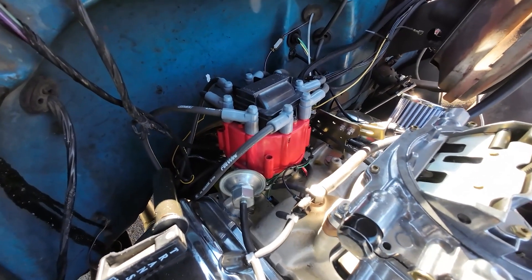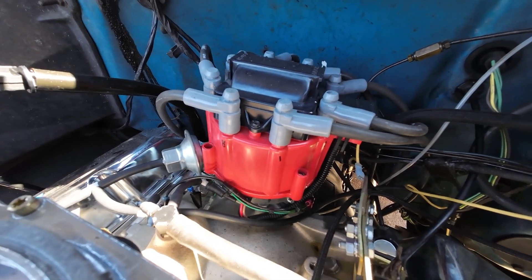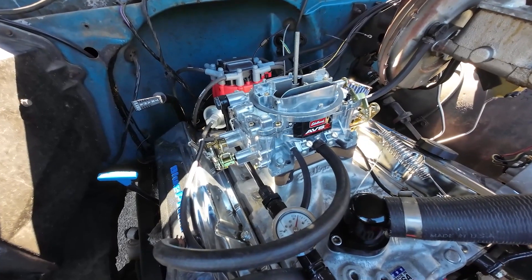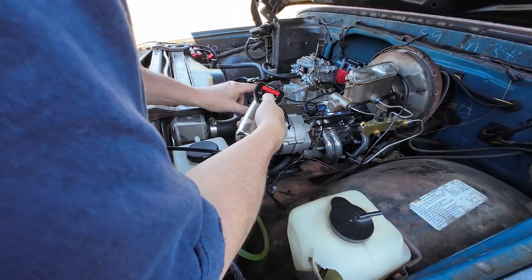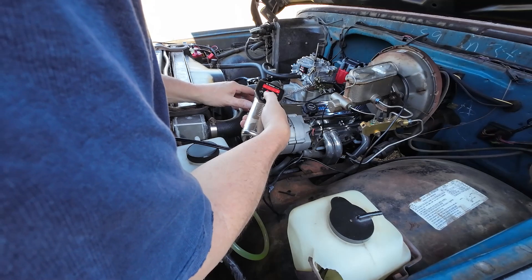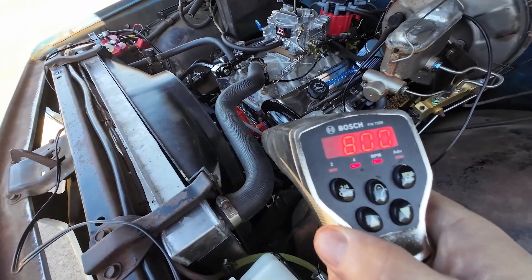The next mistake is probably the biggest one on the list: not starting with the ignition system and timing first. Timing is the number one issue I see with carburetor owners — there's generally not enough of it. When someone's having problems, I ask about their basic setup and then their timing number. Whether it's a small block Chevy, a small block Ford in a Mustang, or a truck, you've got to have enough timing. Today's fuel is not the same as it was in the 1960s and early 70s, and having enough timing is really the basis of everything revolving around how the carburetor tunes.